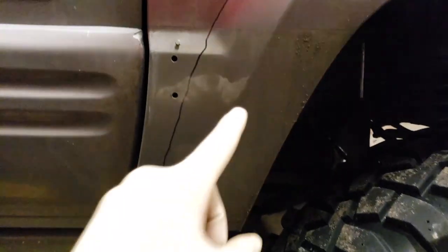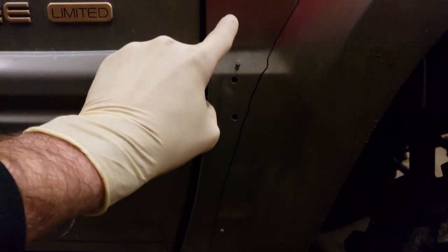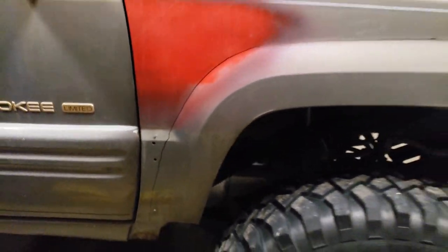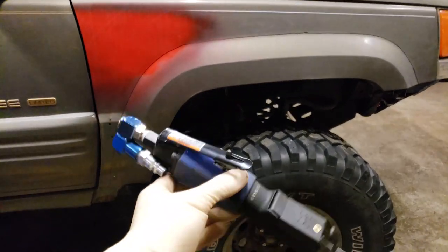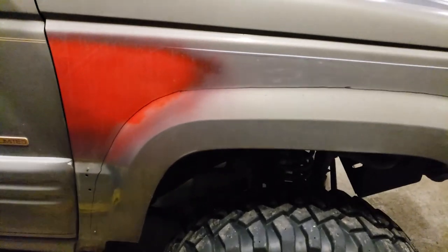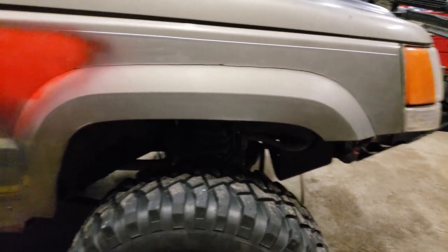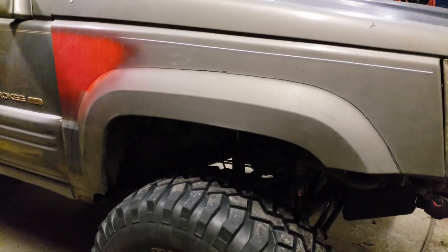As you get down into this section, you want to step out a little bit wider than where that body line would fall, and you want to end outside of this lower pin to make sure you have clearance for the fender to get into this area. Once you've done your cuts, knock this little pin off as well to make sure everything sits straight. I'm going to be cutting right here on the truck using this handy air saw — you could also use a die grinder, or even take the fender off and cut it by hand.